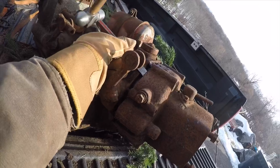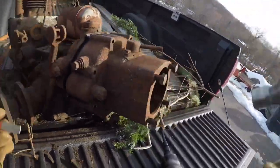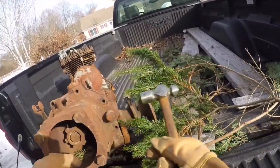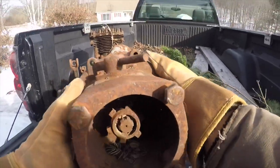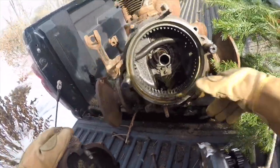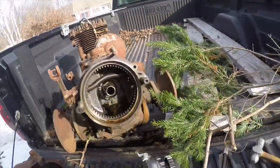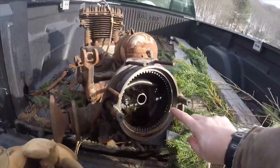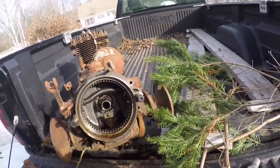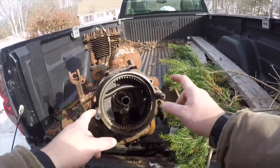That chisel seems to be helping. The dog gear is gonna screw us probably — but there we go. The whole pinion shaft is out. Now the question is: does it have an old style clutch or a new style clutch? Whoa, that clutch looks like there's nothing on it. I don't see any clutch material — it's just metal. What the heck is going on? I had this pipe dream about saving the clutch but it appears to be just metal with no lining.